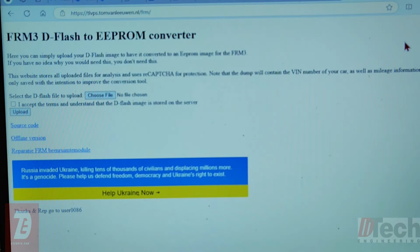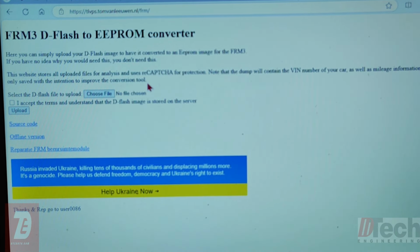Alright guys, so once you've got that file in your drive, bring it over to the PC. Like I said, you're going to go to this website, which I will put the link in the description for you guys to use. And you're simply just going to follow the steps. This here takes a D-flash and basically fixes it. It turns it into a usable EEPROM with that original vehicle's FRM VIN number and coding and so on and so forth. At least that's my understanding.